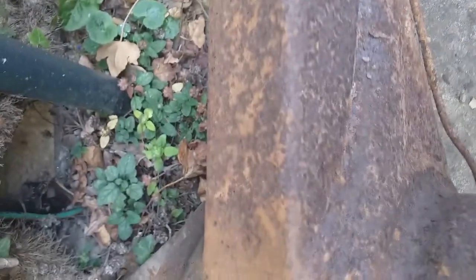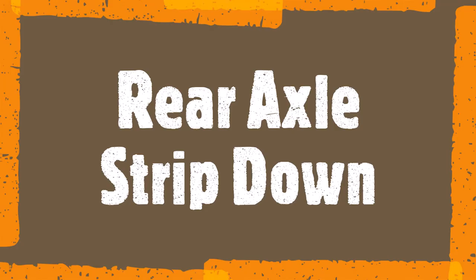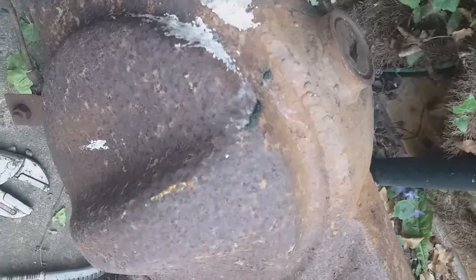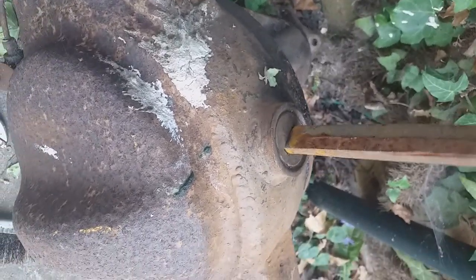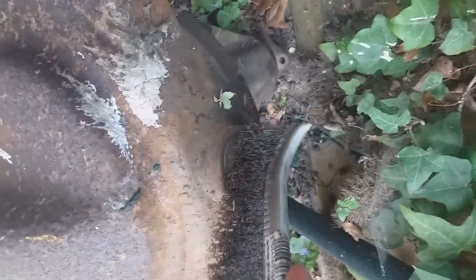There's another drain hole there. It's time to start stripping down this rear axle. The first thing I'm going to do is have a look at the tools I'm going to need. I've got a piece - an off-cut from a piece of angle iron - it's something like 4mm flat bar, maybe 5mm. It fits inside the slot, the drain. I want to make sure the axle is empty of oil. The other thing I'm going to need is a little wire brush to get in there and get that dirt out.